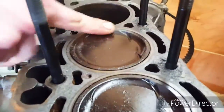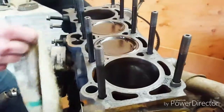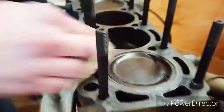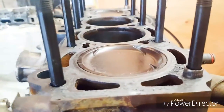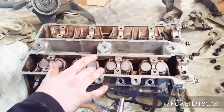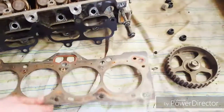It's kind of hard to tell, but these rough spots were from it running lean. It got way too hot and blew the head gasket, even with these ARP head studs. Cylinder 3 is oval, and all these pistons have rough spots on them — they would need to be bored over with new pistons to be usable again. Here's the head with the cam, 16 valve.